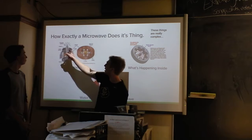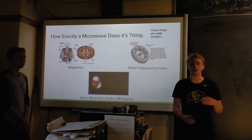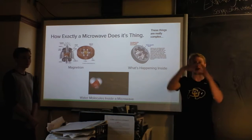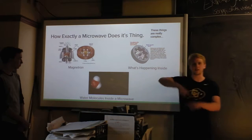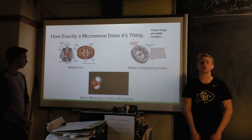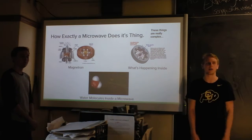Here are the two magnets that create the magnetic field. What happens inside of your food when it's in the microwave — first of all, it's important to note that it only microwaves things that are high in water, fat, or sugars. Water is super cool — it's polar. When it is interacted with by a light wave, it flips around and aligns itself to the direction of that wave. As the electric field inverts, as it does in microwaves, the water molecule shifts and jiggles back and forth. That extra kinetic energy is what the heat is coming from. Your food is being heated throughout wherever it's interacting with that microwave. That was sort of the basis of our experiments — figuring out where that microwave is and what it's doing.